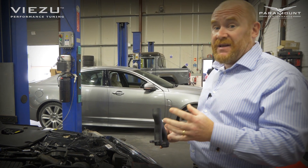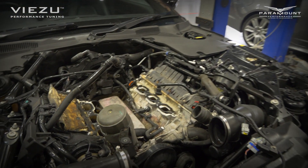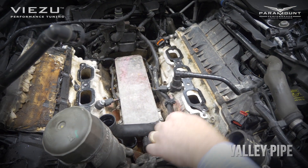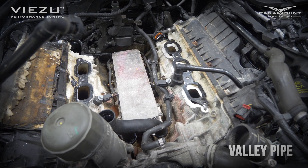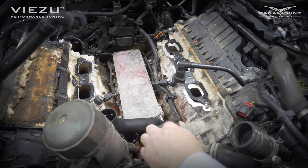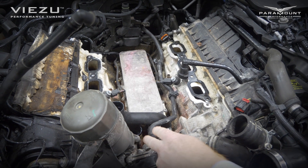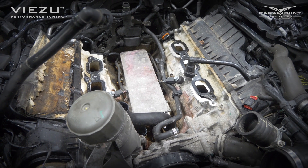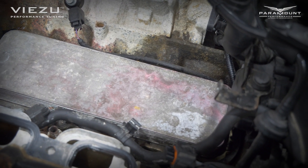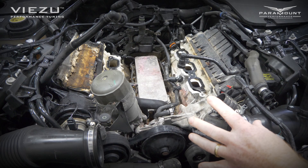This particular car seems to be leaking from pretty much everywhere. It's also leaking from this top joint on the Y-pipe — that's quite unusual, but it is definitely leaking; there's water staining down there. This pipe here is what we often nickname the valley pipe. It runs underneath the supercharger from the front to the back and actually cools the throttle body. This too is leaking — you can see it's got an old coolant stain and it seems to have been leaking from this connection. It's actually normally the back end of that pipe that leaks. You'll see on the back of the supercharger there's a lot of coolant there too. Normally when we've got it off to this extent, we will change the valley pipe, both parts of the Y-pipe, and if in any doubt at all, change the water pump too. They're the three areas that fail on these cars.